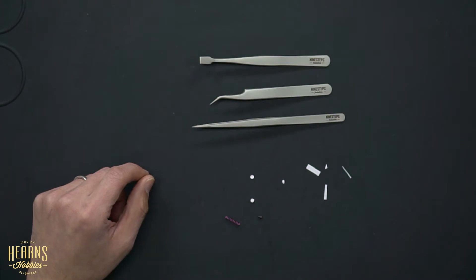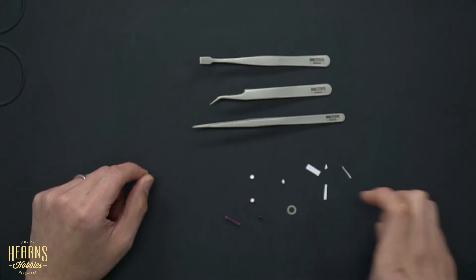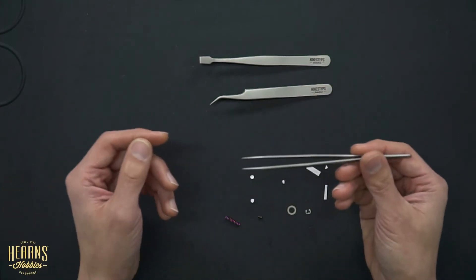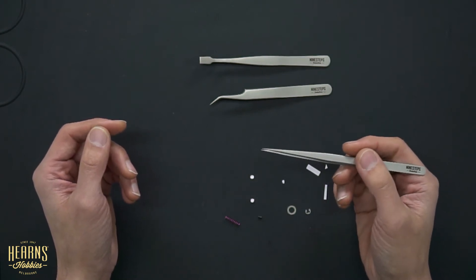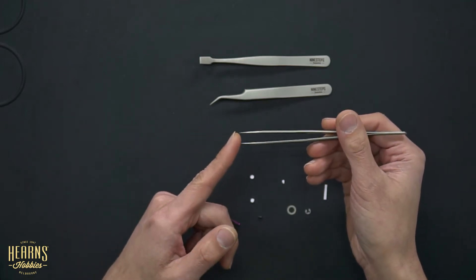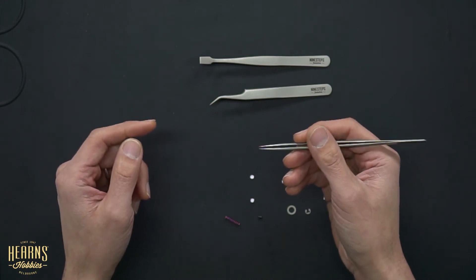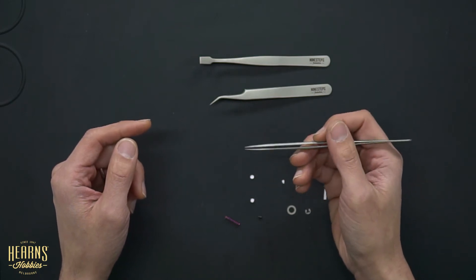In the RC world we use really thin shims, which I can barely pick up at the moment. This shim is 0.1mm — really tiny. Then there's also a tiny e-clip. With the straight tweezers you can hold them at whichever point is most comfortable. Holding furthest back gives you the most reach, then you can move it all the way in to get very close movement with a soft spring action.